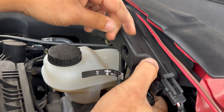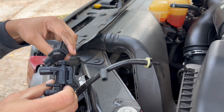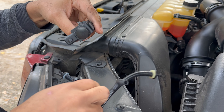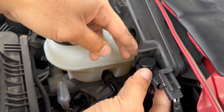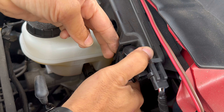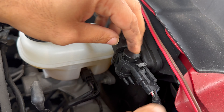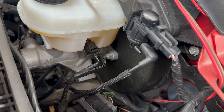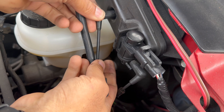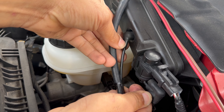For anybody who has a Raptor or a four-wheel drive F-150, sometimes you might start hearing a grinding or a ticking noise and the vehicle starts driving a little weird. The vacuum system is used to keep four-wheel drive disengaged rather than push it into gear. When you start getting those leaks, it'll try and jam itself back into gear — that's where you get that grinding.